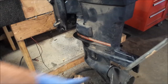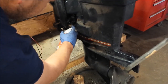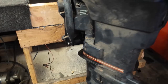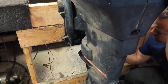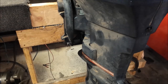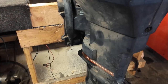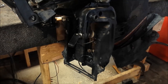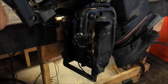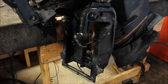Well, that ain't moving. I have the chain hooked up to a J-hook here, and I squirted some PB Blaster around there and hope it does something. Hopefully this isn't a view of what's to come on this motor. This rod looks like it's never been out of there and it is stuck. That thing isn't moving at all. So plan B here — my plan is to tighten this rod down so much that it just kind of breaks its rust seal free. I don't know if it's gonna work, but it's better than getting out the torch and getting it hot.